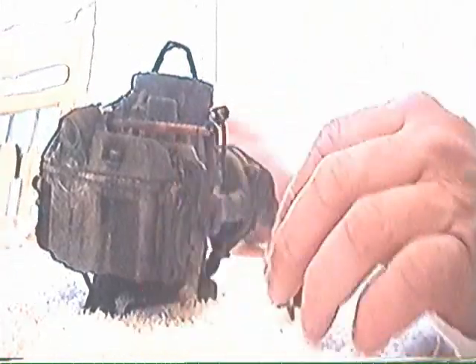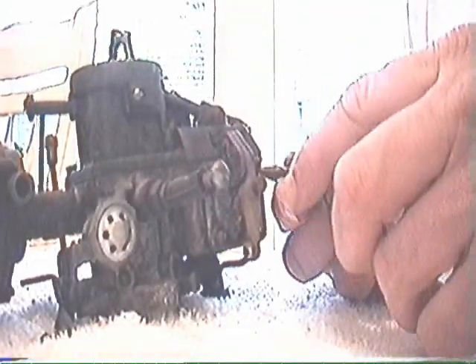I'll take a piece of masking tape and fold the accelerator pump, which will make reassembly much easier. Interesting enough, it has a pump on the other side also.